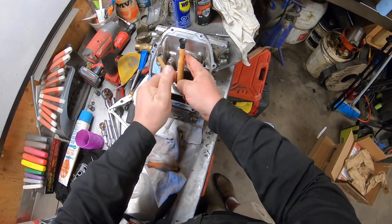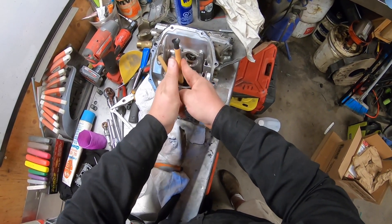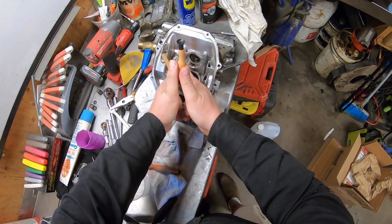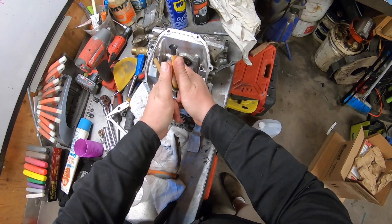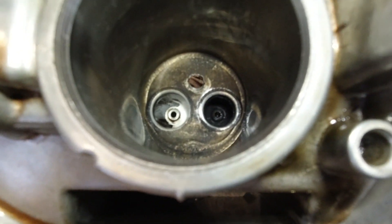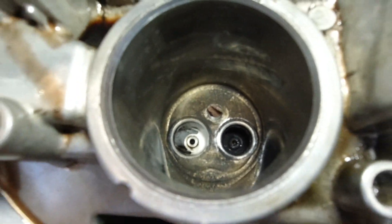You can hear it's all coarse at first. That didn't turn out too bad at all — polished up pretty good, and even inside the cylinder head cleaned up pretty good. Before you reinstall the valves, make sure you've cleaned everything completely out as best as you possibly can, because if you don't it's going to create some issues down the road. Hope you guys enjoyed this video — if you have any questions or comments, post them below and I'll see you in the next one.